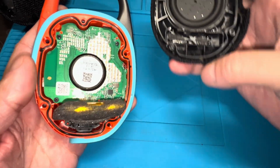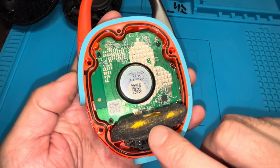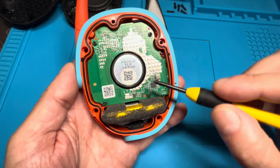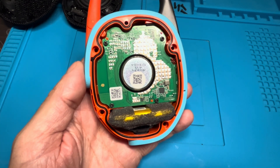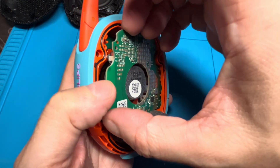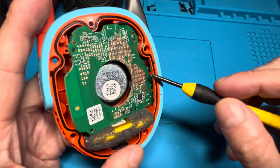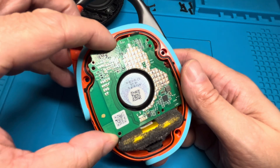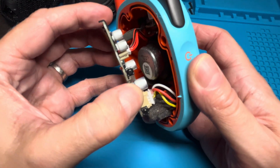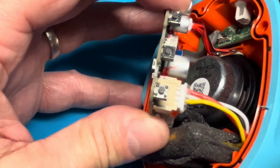Here we have the back side with the passive radiator — that's the big round part in the middle. Then we can see the battery here in a golden color sitting in a little padding. To remove it, we need to access the back side of the PCB, so we have to remove four smaller Phillips screws. Then we can carefully pry off and lift the PCB — left side first — since on the right side the PCB slots into holes for the buttons. Wiggle it out carefully because there are wires connected to the body and we don't want to accidentally tear any of those off.